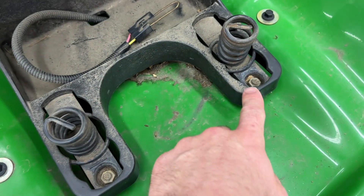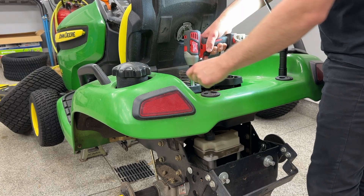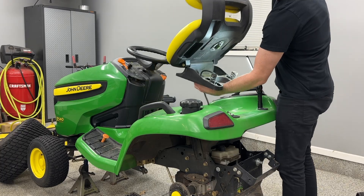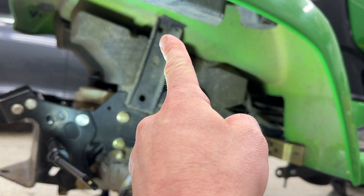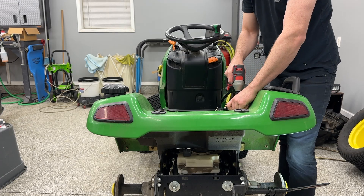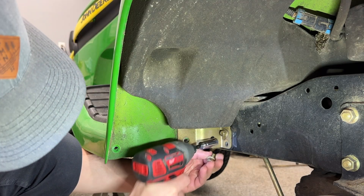The seat is held on with four bolts. This is something you don't have to do, but I wanted to do it because the plug under the seat — I didn't want any complications with that trying to lift the rear bodywork off and having it snag on the plug. There are two bolts underneath the seat that go directly to the frame braces — go ahead and pull those out. In the wheel well there are some bolts and brackets. Some of them you can get by with just loosening, but I went ahead and removed everything. I like doing things the easy way.